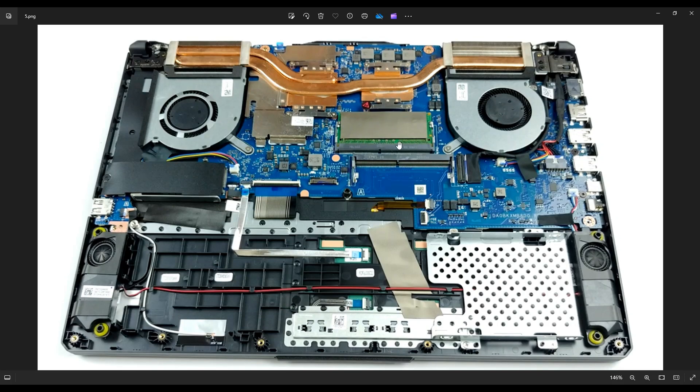To put the RAM back in, you would slide it into these ports — you have a long port and a short port, so you can only get that RAM stick in the correct way. Put it in there, make sure it's flush, and then you press down in the center and the metal arms will latch on to it, securing it into place.